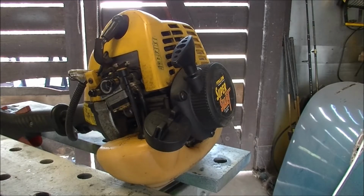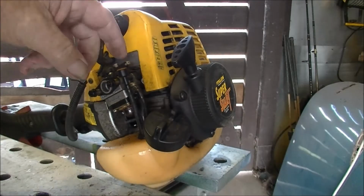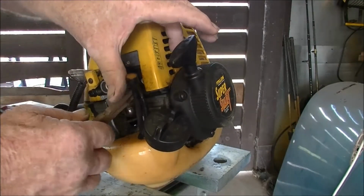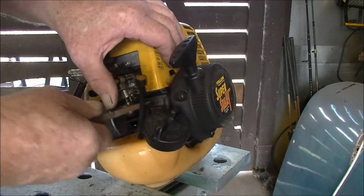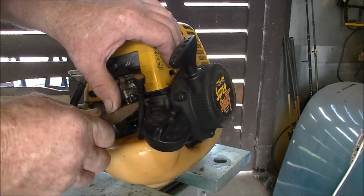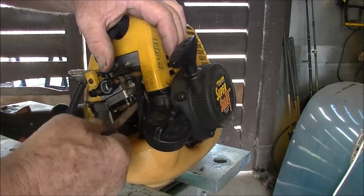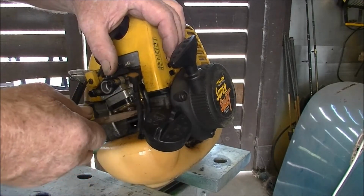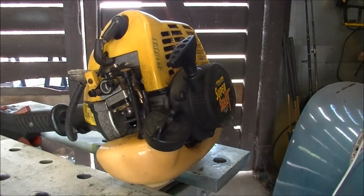So take the carburetor off, I guess, and open that up in the bottom and see if we can locate the main jet. And we're going to need to pull some hoses off over here. Okay, remembering it's the one that goes up from the back, comes up to the front, and the one that comes from the front goes to the back, off like so. Yep, happy days.